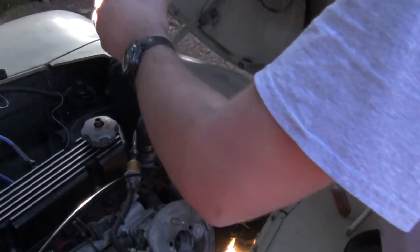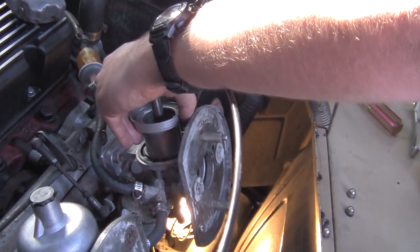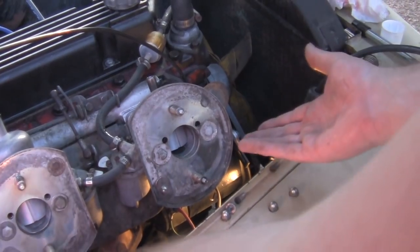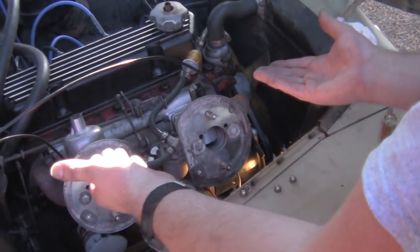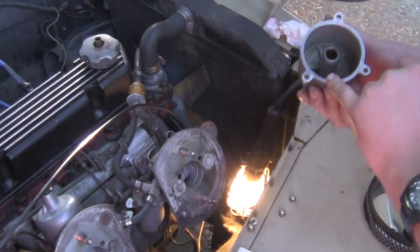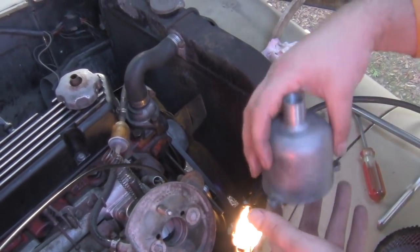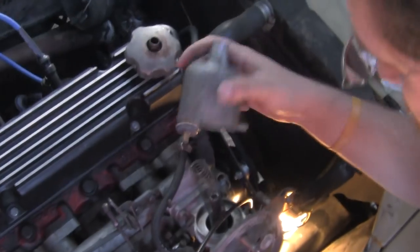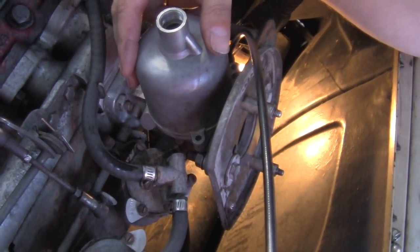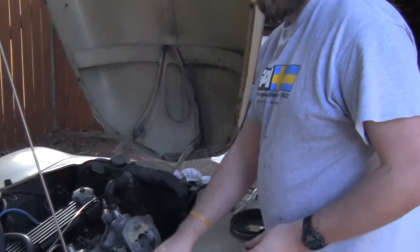We'll go ahead and reinstall our piston, being careful not to dent or screw up the needle. It should sit right there. When we had both carburetors apart, we did our baseline settings — adjusting both nuts up to be flush with the venturi and backing them down 12 flats, just like it says in the book. We'll return our spring and reinstall our dashpot. It's kind of an odd shape — it can only connect one way, so if the screw holes don't match, just rotate it until they do.